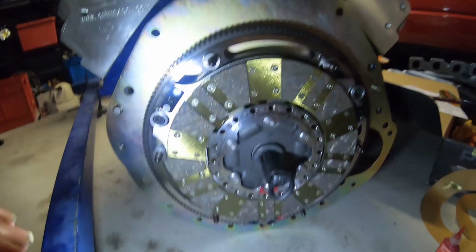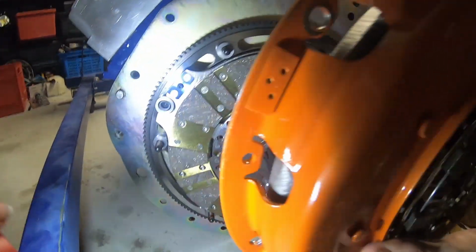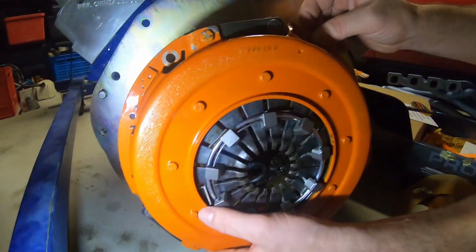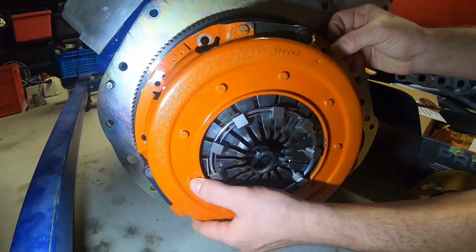And we'll get ready to run through the torque setting here. With these, you've got to go really slowly, guys. You've got to do a quarter turn, the nuts a quarter at a time on all 6 studs all the way around. It takes a while, but it's the only way to do it.